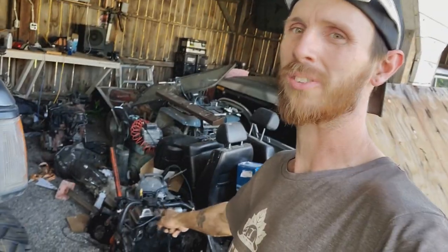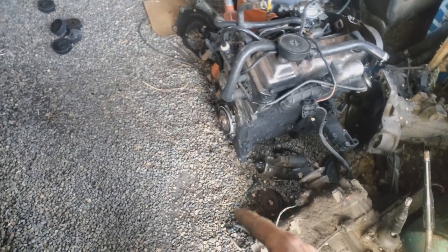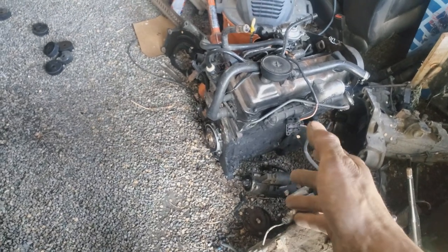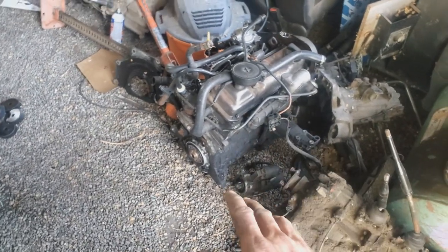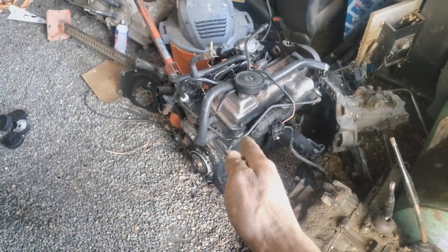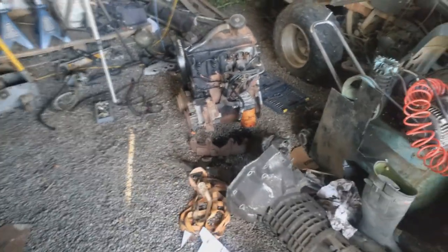One thing I figured out — I've got a setback with the Mazda flywheel on the Volkswagen engine. Just for fun, I took the flywheel to the shop and fired it on the balancer. I wanted to find a high spot so I could grind it out and try to balance the flywheel myself. In doing that, I noticed the flywheel had a little bit of a wobble, so I can't use it. That really sucks because that flywheel and that plate — I paid roughly $850 bucks for all the work done — is now useless.